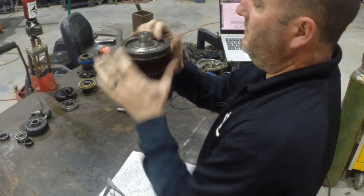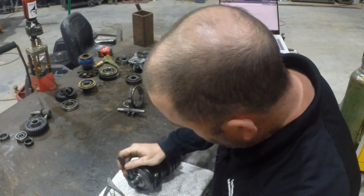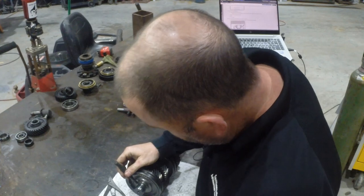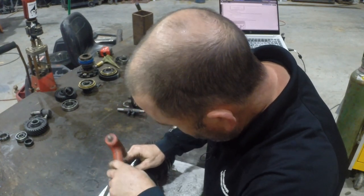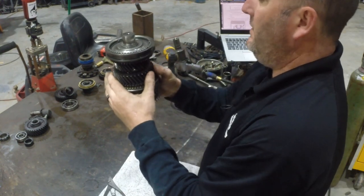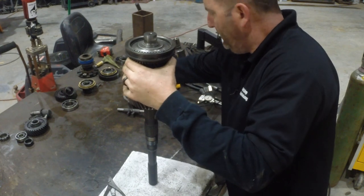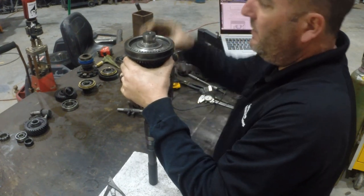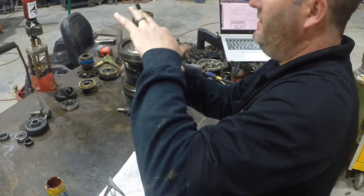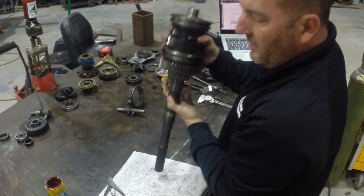Flip it over, grab him, slide him down. Make sure he slaps into his little hole — may require a little assistance. Just gave it a little help so that it would jump down into its groove. Third gear still spins, second gear still spins. Nobody's loose, which feels good. Third gear brass is spinning. I have a thrust bearing for the input shaft that's going to want to fall off and make my life miserable, so I'm going to take a little bit of grease and stick it where he goes — now it's stuck on there.